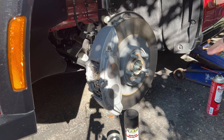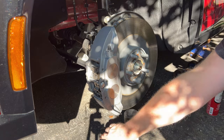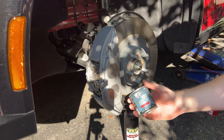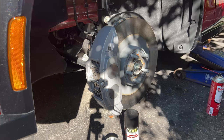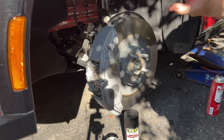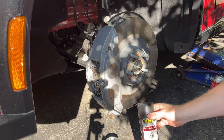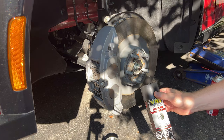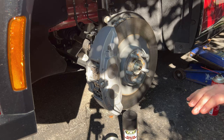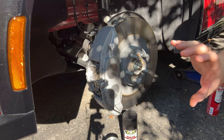These are legit Brembo brakes. What we're going to do today is paint the actual caliper with this Por-15 caliper paint — it comes very highly recommended. I like it because it's a brush-on, so we can apply it exactly where we need it. For the actual rotors, which might be a little overkill, there's the VHT caliper paint — I've used this on all my vehicles and it lasts a very long time, even in Canadian climates with salt and brine on the road.